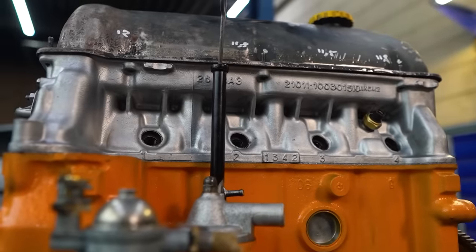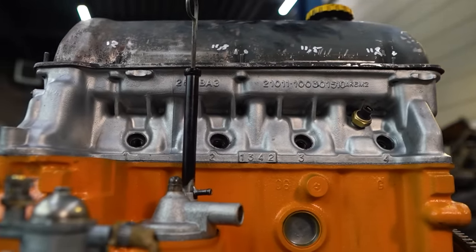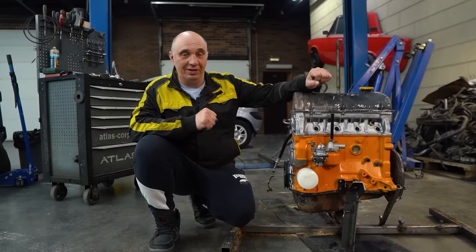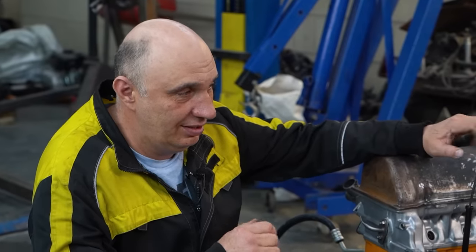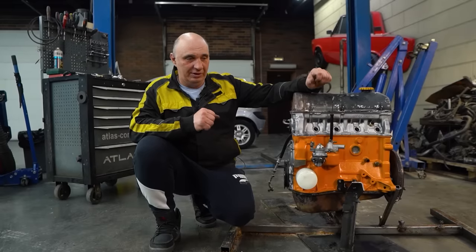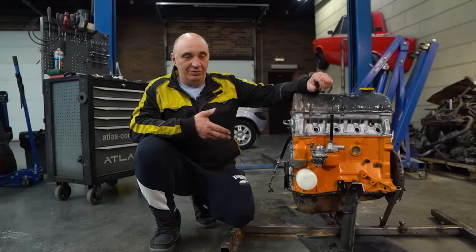We were looking at about 12 kilos per cylinder when we administered the test, and we want to bring that up. And by bring up, I mean really crank it up. Like literally as high as we can possibly get it. As for how we go about doing it, well, we actually have a couple of options of how to boost the compression.